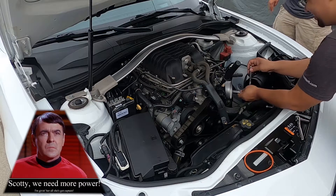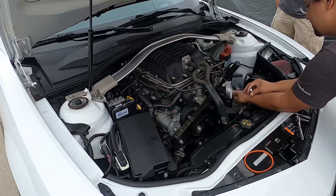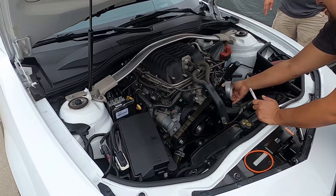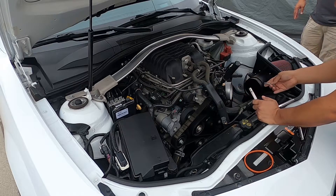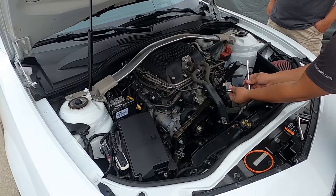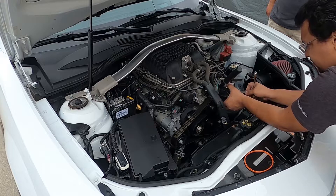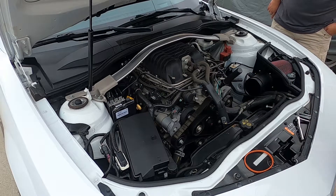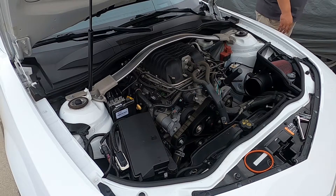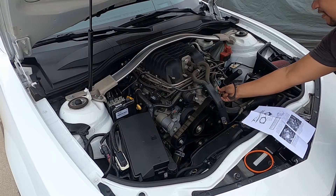By the end of this video I'll show you an inside view of how it launches — it actually feels pretty good, but I won't spoil it just yet. As I'm pulling off the throttle body, like I said, it's four 10-millimeter bolts, and there's a wire connected to the throttle body that needs to be removed as well. I'll throw a link up top showing how to remove the intake piping. Right now we have an aftermarket intake, so there are two large hose clamps holding the piping together — loosen them, pull the piping off, and you can get right to the throttle body.